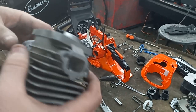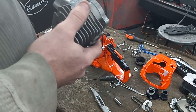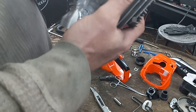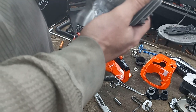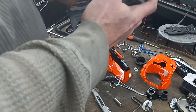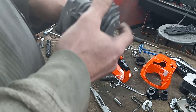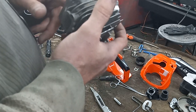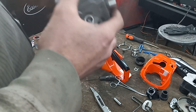How I'm going to fix that problem — I'm still going to carry on, I want to build this thing as a proof of concept to make sure I can get it to work, because I know it's not going to last long. I can't even feel it with my finger, the transition from that plating to where it's not, because the hone feather-edged it in real good. But it's going to wear quick, and there's potential that plating could lift and catch the piston.